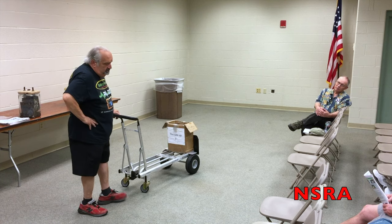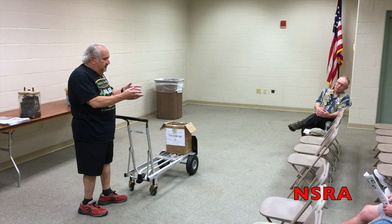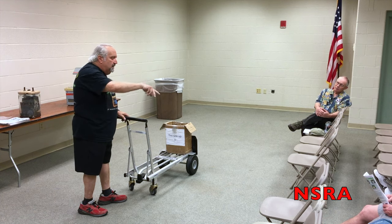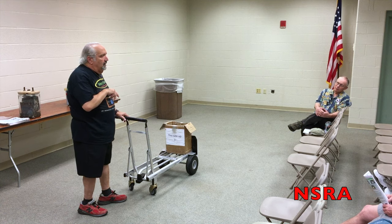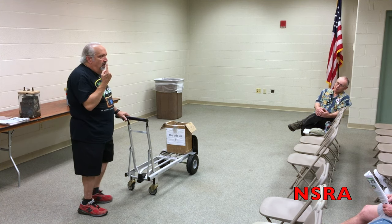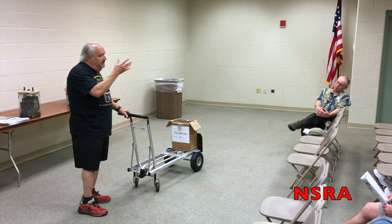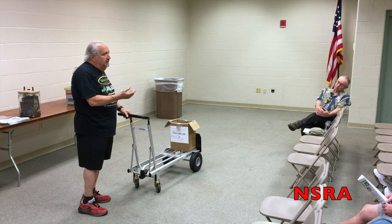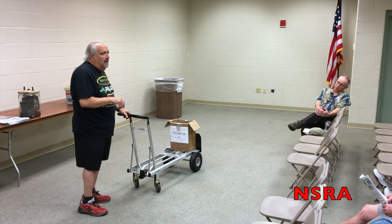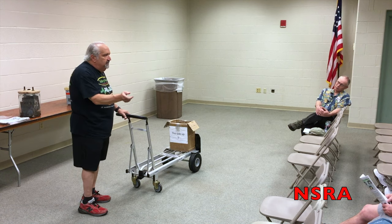There's nothing wrong with daisy chaining and making small wire cables that can jump your three or four batteries together. I do it all the time, and I have one charger on all four of those, pulsing them and keeping them alive. Even if you have different brands, as long as the charger is powerful enough, say 5 amps, and automatic, you can put four batteries together, all the reds and all the negatives together.